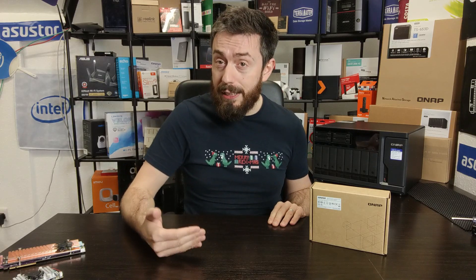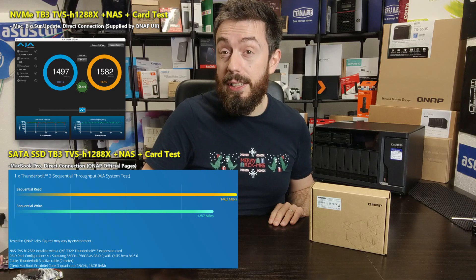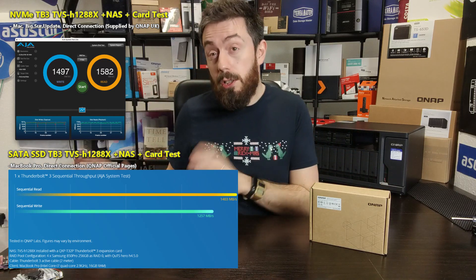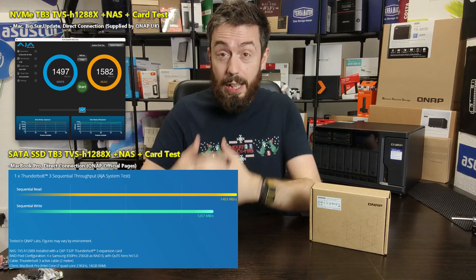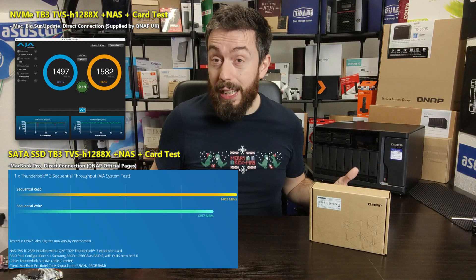It's worth highlighting that this card arrives on a PCIe Gen 3 x4 interface, which I know some of you will be a little disappointed by. PCIe Gen 3 x4 allows up to 4,000 MB/s connectivity between the card and the board, but that means two connected users running simultaneously would only get 2,000 MB/s each. Bear in mind this is still Thunderbolt over IP, and I very rarely have ever seen a Thunderbolt NAS exceed 1,600 MB/s anyway — so as bottleneck-ish as that PCIe may sound, the IP protocol means you couldn't reach those boundaries anyway.